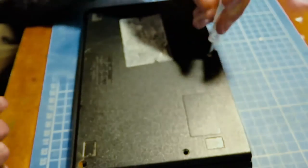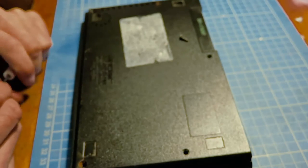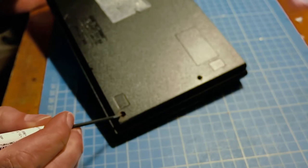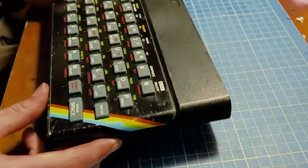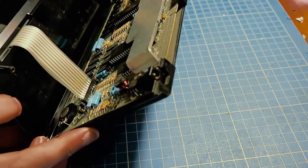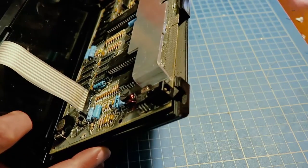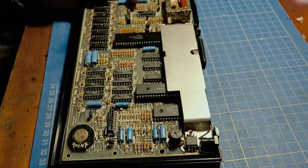That screw's done in there well — actually, that's not even the correct length screw. I notice there's a bit of rust in the screw hole down here, and rust in there as well. Let's have a look, shall we? Someone's — yeah, the membrane and ribbon is snapped on that side. In fact, the other half is still stuck in the keyboard connector. That one was just very loosely put in. Put that to one side.